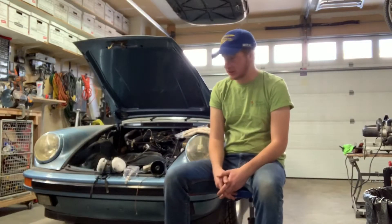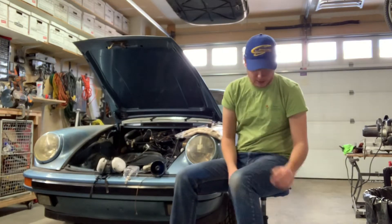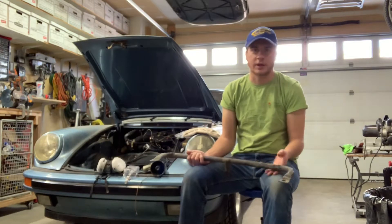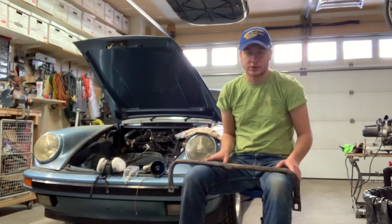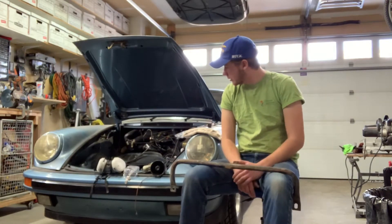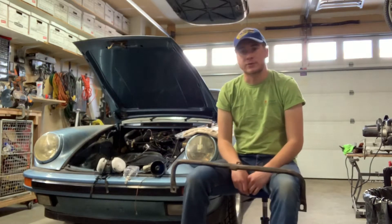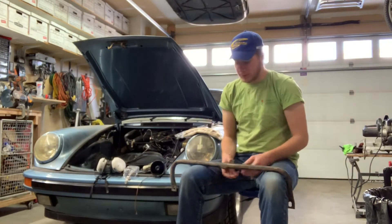The first stuff to go is what I mentioned. I also had to remove the AC bracket up at the front, and there was sort of an almost radiator-type thing up there, so we could get to where the rust was the worst. Then we're going to take off some of the front suspension components and get it jacked up independently with no load so we can cut it out. Before we do that, we have to take measurements and be very precise, because if you miss it even a little bit it could be really bad.